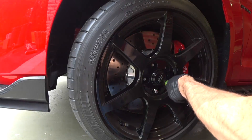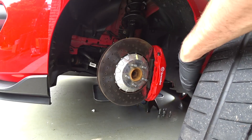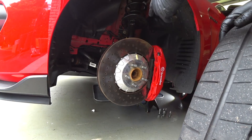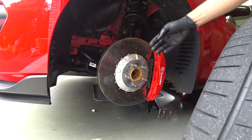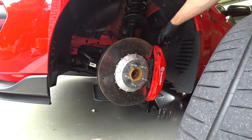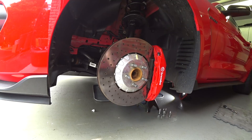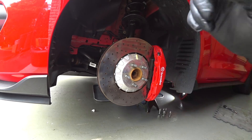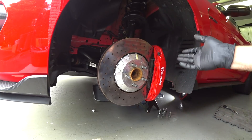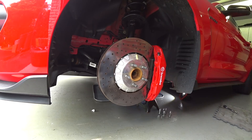While we're waiting for the oil to drain — whenever you're working on your car, especially the Shelby with the tight tolerance between the caliper and the rim, you have to be strong and lift the wheel off the car. If you just push it off and it drops, you're going to scratch and damage the finish on the calipers. Also, always rotate the tire and inspect it for any punctures, screws, or nails. Do it now while you have it off the car — you might catch something in advance and avoid a roadside breakdown.